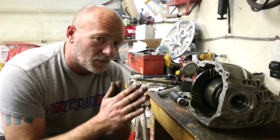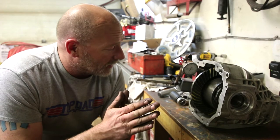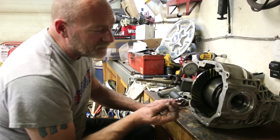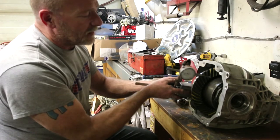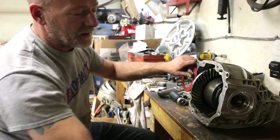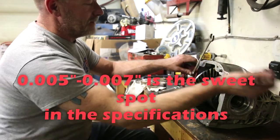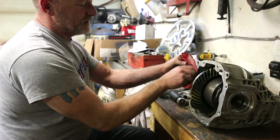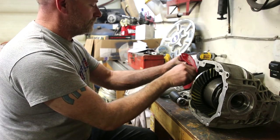So now we've arrived at 6 thou backlash. You could argue for 6.5 thou, but a comfortable 6 thou backlash, which 5 is the minimum spec, and I'm happy with that. Very happy. Everything is now torqued in place.